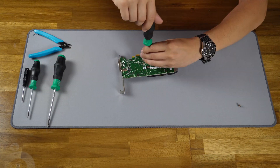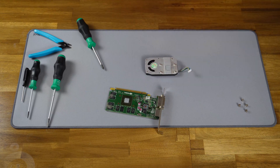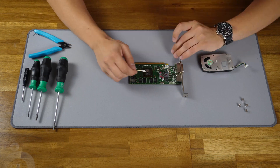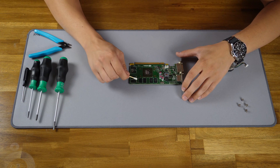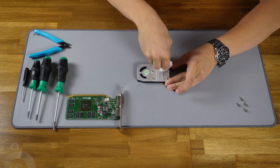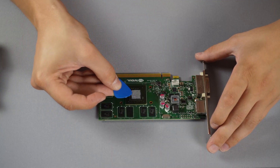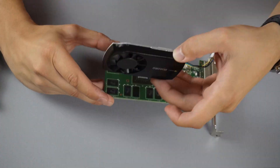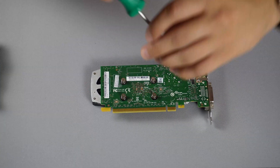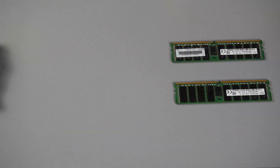This GPU is very easy to disassemble. The cooler is held by 4 screws on the bottom. I'm glad I disassembled it because there was a significant amount of dust in the cooler and beneath it, and the thermal solution had hardened significantly. To be fair, I do not expect to have thermal problems with the GPU at all because as a home server it will rarely be utilized, if at all. I put the card back together and I apply a thermal solution. This card does not have any thermal pads. With the GPU reassembled, I lightly cleaned the memory and the optical drive as they were relatively clean.